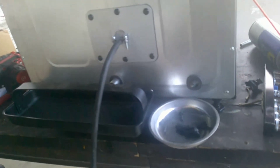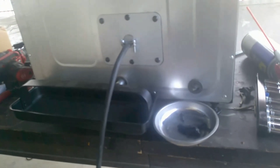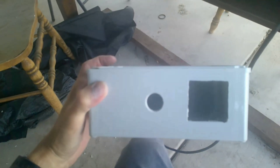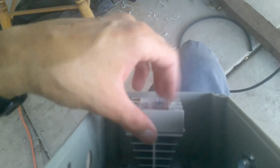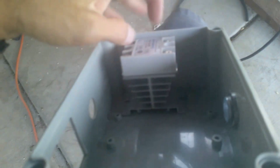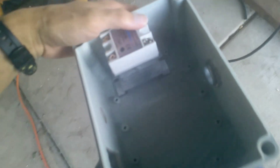Before I get too far ahead, I want to show you the progress. I cut the power whip off the back of the unit since I'm never going to put this back to stock - but if you feel uncomfortable with that, you can just tape it up and put it back later. On the box, I cut the square for the controller and a little circle for the on/off switch. I installed the relay - the bottom had a metal plate that attaches to the aluminum heatsink and I put some thermal paste in between just for fun. Then I took the whole assembly and put double-sided tape on both ends to stick it down in the box so it doesn't clunk around.